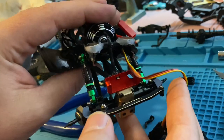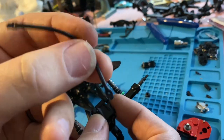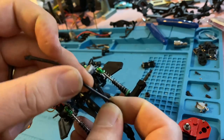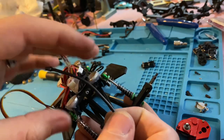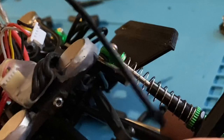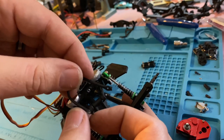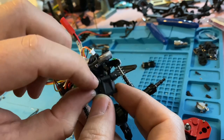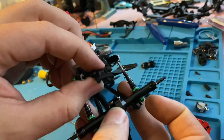Then we'll just have to do the rear. For our rear limiting straps, we've got a spot here to mount. We're going to use the same thing. This is just de-wired — it's the sheath from a wire and I cut it in half. There's a lot of different things you could use: rubber bands, but this is more stiff and more flexible with a little stretch. I like this material a lot. A rubber band is usually just too stretchy. Chains are cool too but hard to find in scale. What I think we're going to do is drill a tiny hole straight through our truss at an angle, not hitting where the links mount, and try it there. There should be enough meat in there to get a good screw in before we hit the axle.